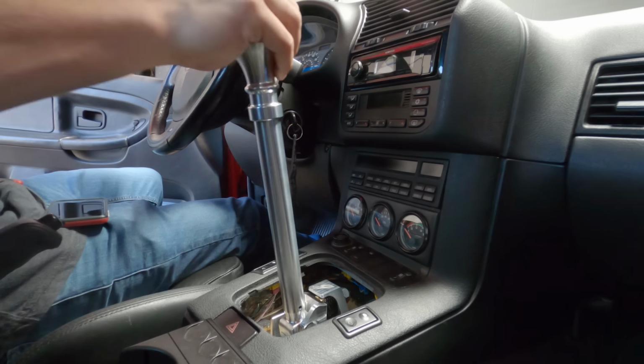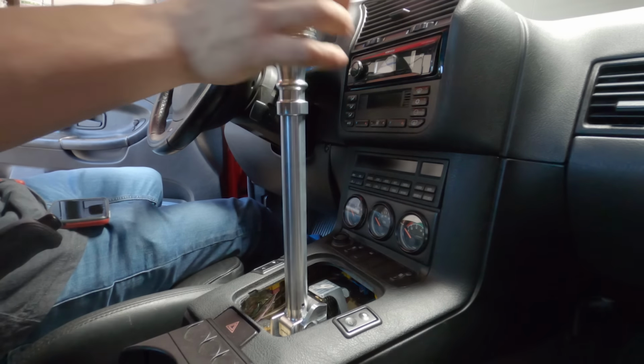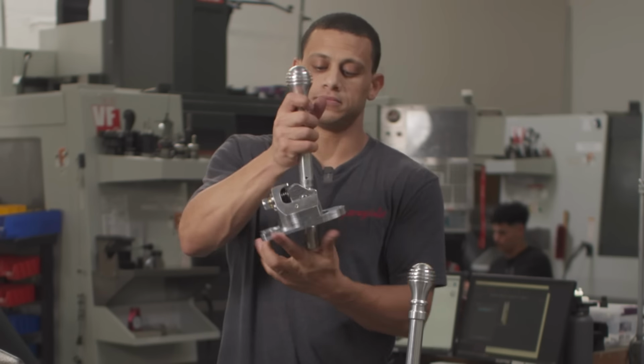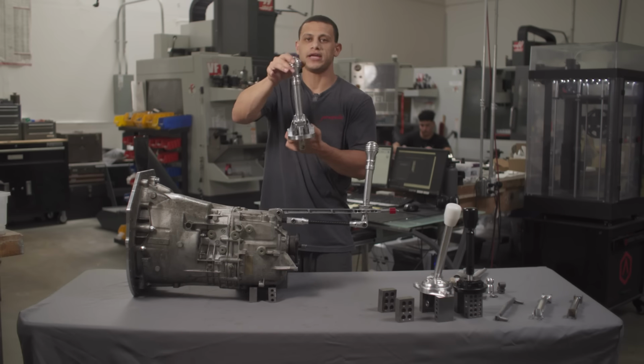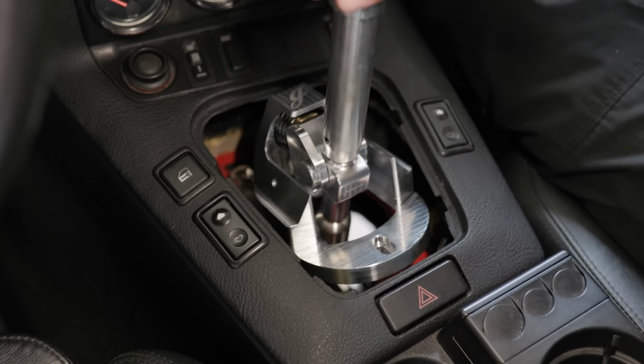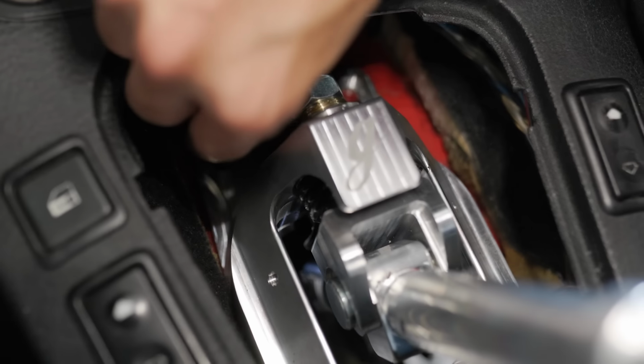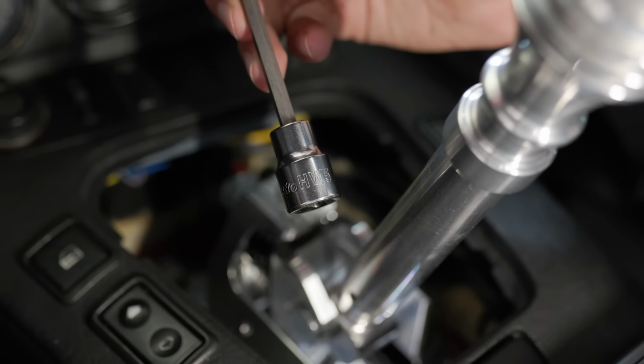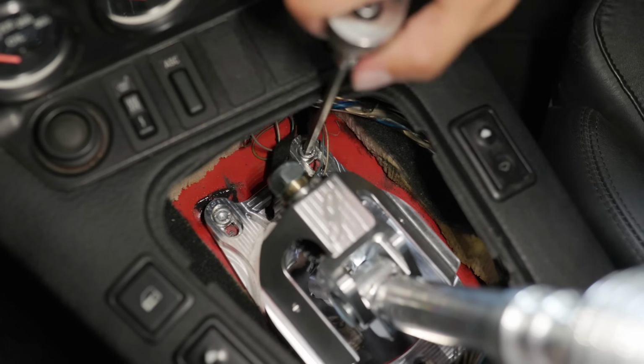It's pretty cool. There's a spring in there, and it actually just has tension left and right. And this basically makes it where even if you do have play, it's gonna pull it to the center. This does band-aid a lot of the other issues, but if you do it properly and you still do the selector joint and the DSSR, you're gonna make sure that this system works really well for you.